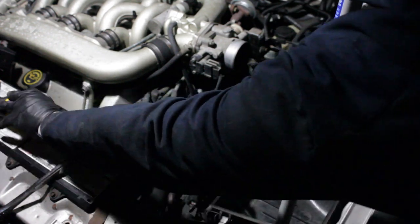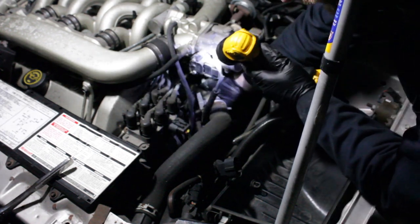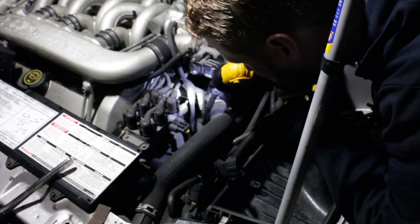This is not an easy go, guys. It just pops off — most of these sensors don't really screw in. Sometimes they'll have a clip but oftentimes it's just a pressure fit that you push on. Let me check the wire itself and see if I see anything obvious. No — wire looks to be in good shape, no exposed copper or anything. Maybe I can clean the connector in there. There's the sensor right there — we'll get a wrench on that and pull it out. We'll run a resistance test and voltage test to see if the sensor is reading. It's a cheap sensor, like a seven-dollar sensor, but let's just test so we can confirm it's not a wiring issue.